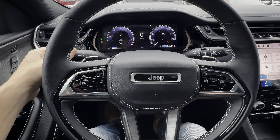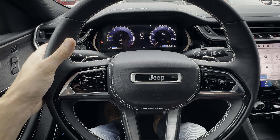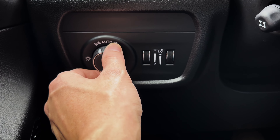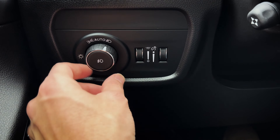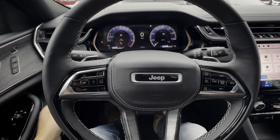The stick on the left-hand side is for your blinkers, high beams, etc. You can see the high beams aren't locking out, and that's because just down by your left knee, you've got to change the switch out of auto mode. Changing the switch to anything but auto mode would give you the flexibility of permanently locking on your high beams if you want to.